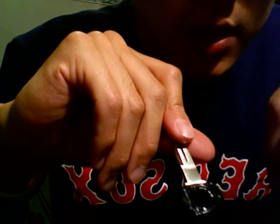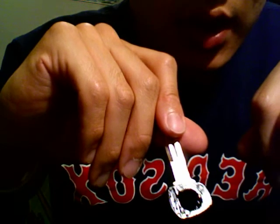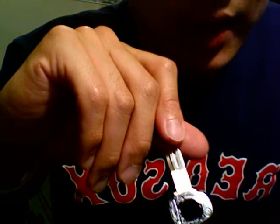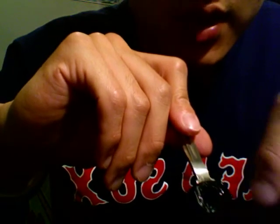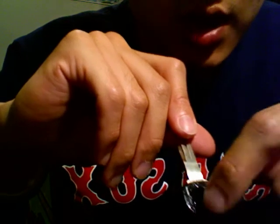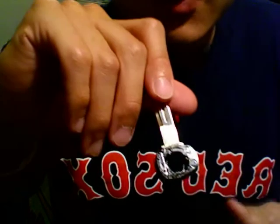That's about it. Make sure of the immobilizer, there's a chip within the glass tube. The chip is actually going to be a wire-spun tiny little screw-looking thing within, looks like a pellet of rice. Inside there, it's not going to be in there evenly. It's going to be moved to one side more than the other. So make sure you position it so that you shave the side where the chip is not, and there's some empty space to give you some play. So you can experiment. Email me back if you have trouble, but basically that's about it.